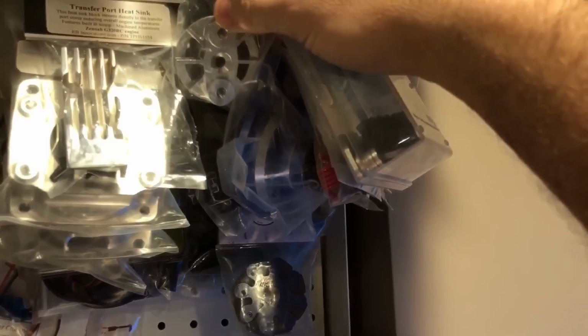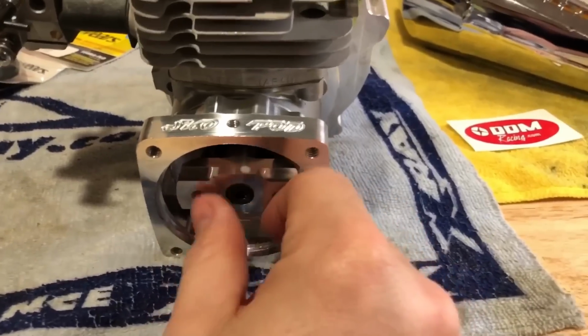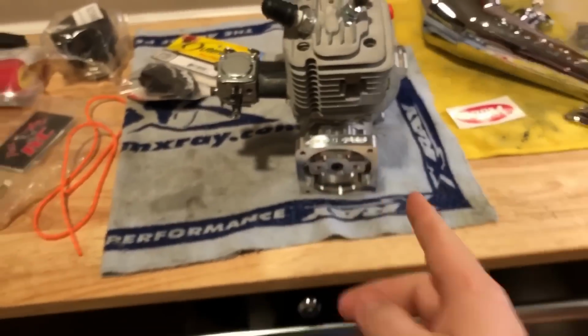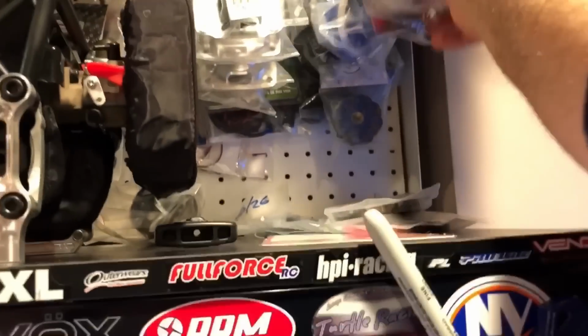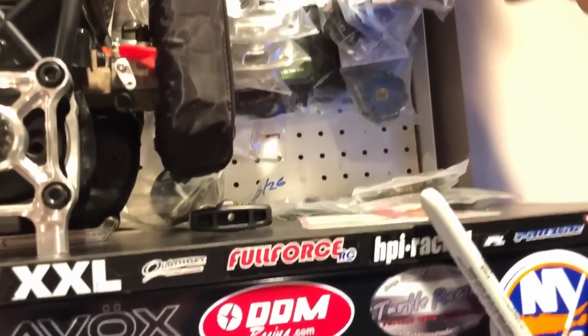this fan. All right, you have to get rid of this here on your crankshaft. You get rid of this. This is a different one from Sculpot anyway, a nicer one. But you get rid of this and you install that, and you will bolt your clutch onto that fan. And that fan will help out, believe it or not, big time. And you can run your clutches like this, or whatever clutches you like with that.